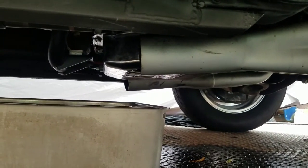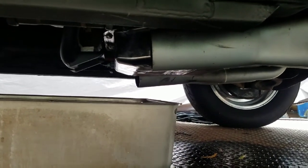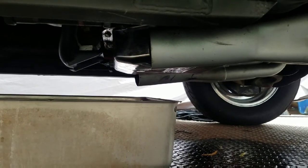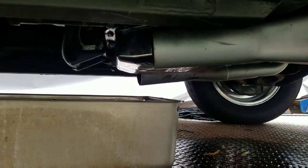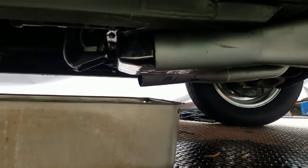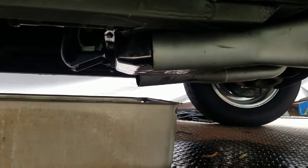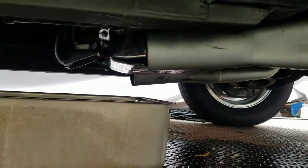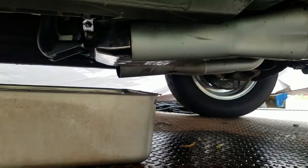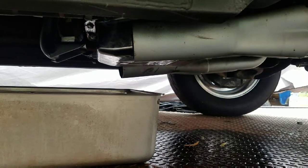So when I make my own gasket, you know, I got the gasket, I got silicone against the transmission, gasket, silicone on the pan. That way I had that little smush, you know, to take up. I didn't want to crush the pan, so I used it. This time I'm going to take the pan off, and I'm just going to, like I said, make a gasket, do away with all of it, and see if I can seal it off that way. And if not, like I said, my only other option is to get another pan, get an aluminum pan that doesn't have those ridges or nothing, you know.